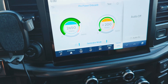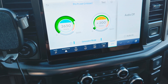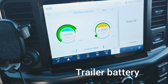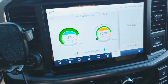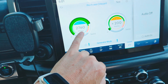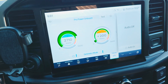If we turn the air conditioning off briefly, you can see it sitting there. My understanding is that this will use about a gallon of gas every hour if you're sitting at your campsite, so with a full tank you could go over a day. Basically what I have it doing right now — the reason we're pulling that many watts — is that I'm actually charging the battery. We'd probably be pulling a few more watts but my solar is also providing some power to the camper battery. This is charging the trailer battery right now, and because we're at 30 amps at 120 volts, the other half of the 240V circuit is completely unused. If you needed to use it for something else, you could plug into the B circuit and still use that as well.